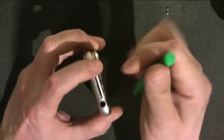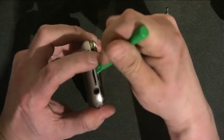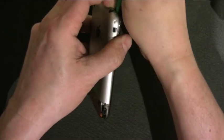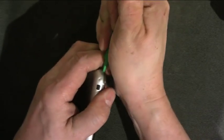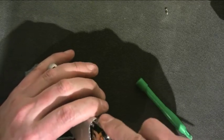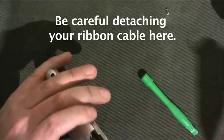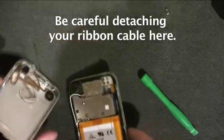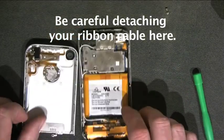This is actually good because the gap around the back casing and the rim is pretty big, and you just got to work it in there. You'll be surprised how hard it is to pop it off, and this is why a lot of aluminum cases on these phones get ruined. You can see right there that I popped a little bit of the aluminum, but you can bend aluminum back.